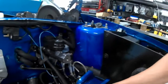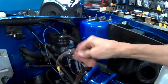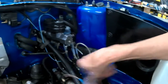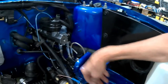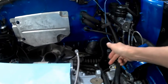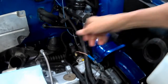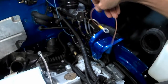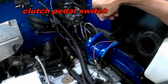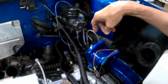On one of the videos I talked about the ground for the start circuit. This shows you a little bit better of where it was. I can't remember exactly where it grounds in here — I want to say it's to one of these bolts, or it could be to one of the ones on the transmission. I don't know where the stock one was, to be honest. But I'll end up running this back to the clutch and it'll ground out to the clutch, so you've got to depress the clutch to get it to start.